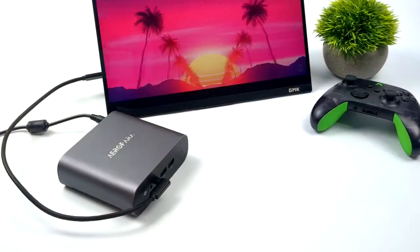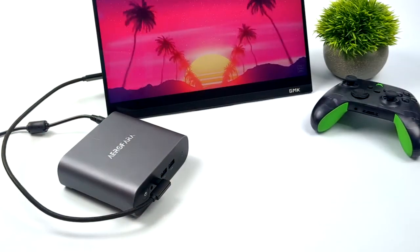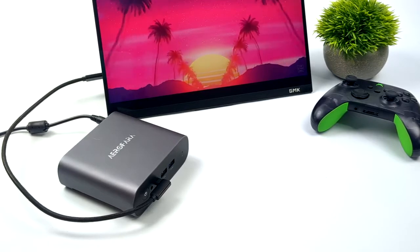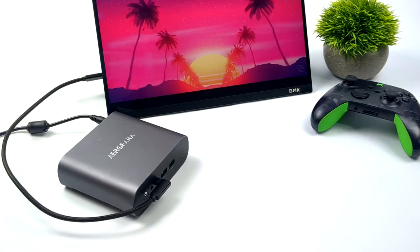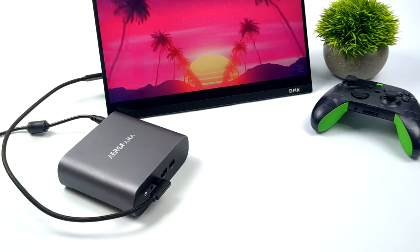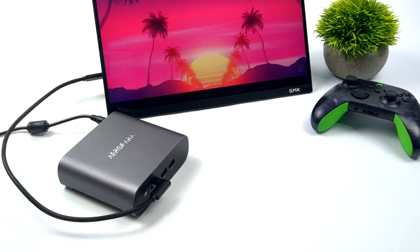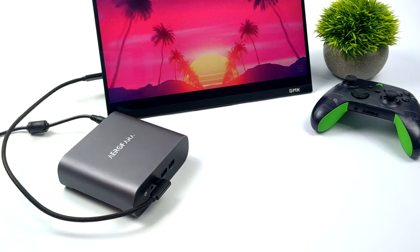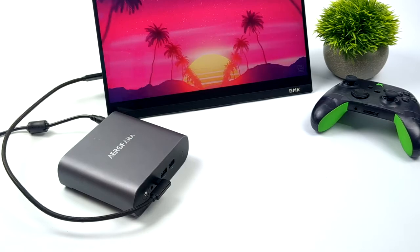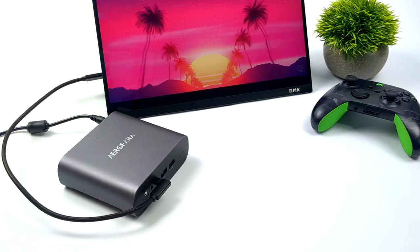So in the end, the Tank56 is actually putting out some really decent performance. I'm glad that they have this TDP set up so it's kind of adjusted according to the settings in Windows, but from the BIOS, we could always lock this at 30 watts if you want to. You can go lower. We've also got a fan curve that we can adjust there. But for this video, I was just using the Windows power management settings, and it balanced. It runs at about 12 watts, and in high performance mode, as you saw, we can hit up to 30, a little over around 33, I think we saw it kind of peak out at every once in a while.